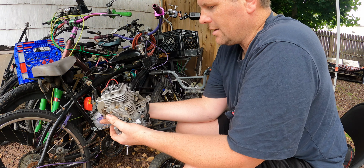In any four-stroke motor, the easiest way to get power is in the head. The reason I say in the head is you want to open it up to get more air. So we did open it a smidge. I don't think it's going to make power. Don't get me wrong, I'm not saying we're making power. I'm just saying I think it will flow slightly better, so it may be a little crisper, if anything. But the big issue is figuring out where and how all this goes. This was a while ago, and this was a mistake waiting this long.